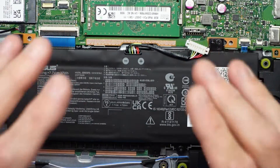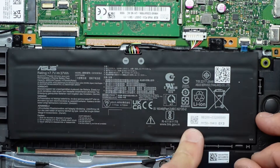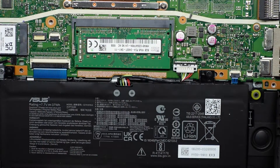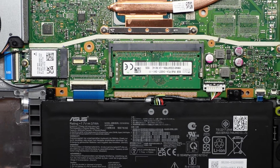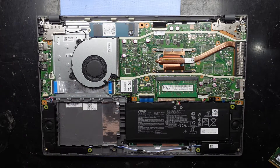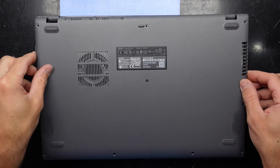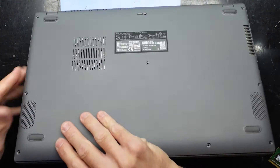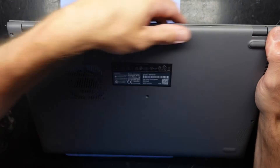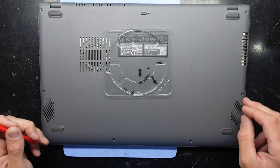I've upgraded the RAM from two 4-gig sticks to a 4 and an 8 to get 12 gig total. Reconnecting the battery — push it back down and pull the tab forward to lock into position. With the RAM upgraded, you simply physically install the RAM and the machine should be fine. You may not have to remove the battery, but I do it in videos just to err on the side of caution. Put the cover back on, click it around into position, then put the screws back in. Remember: the smaller screws are the four along the front, and the larger screws go anywhere around the back.